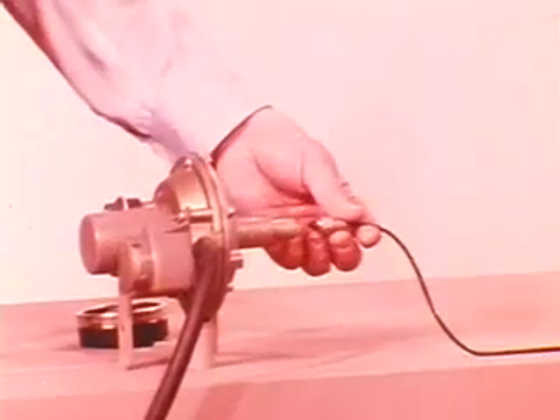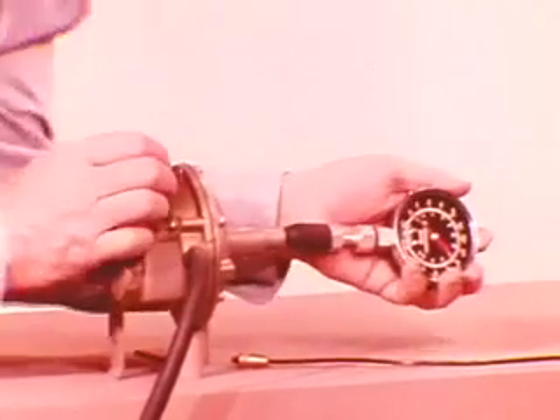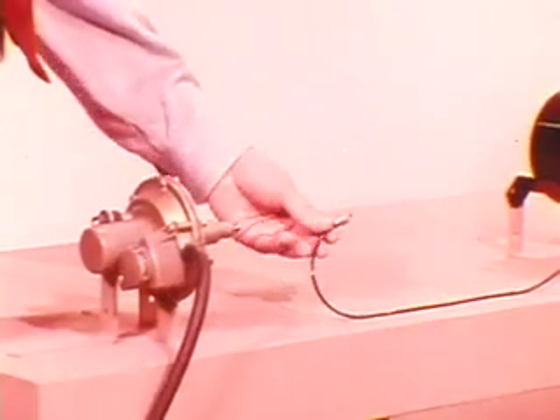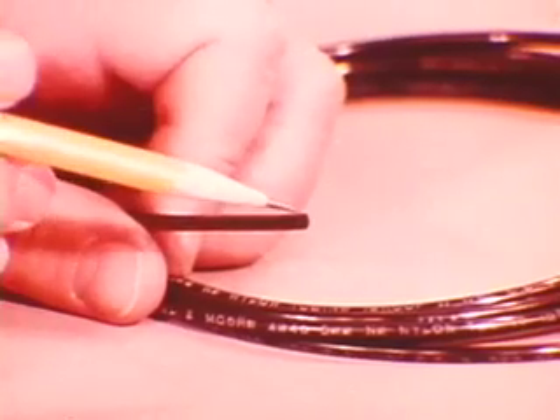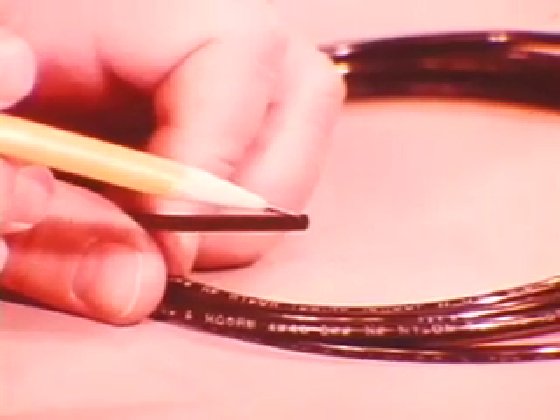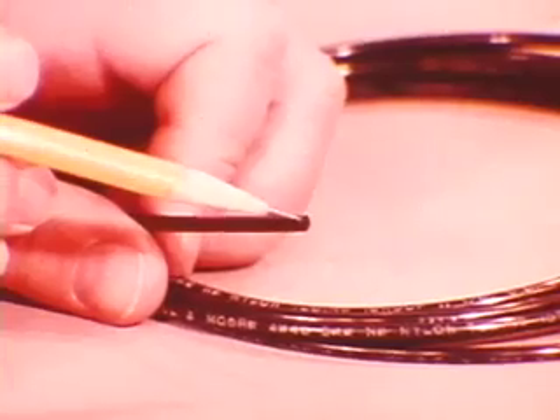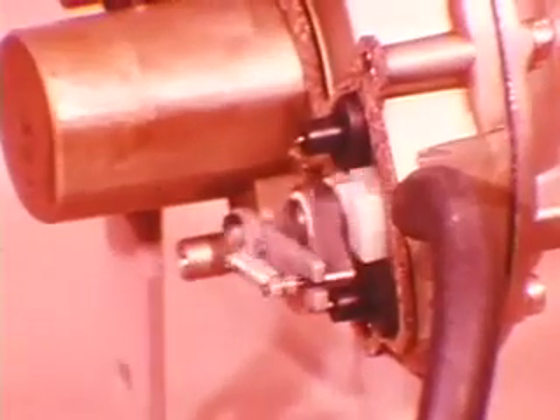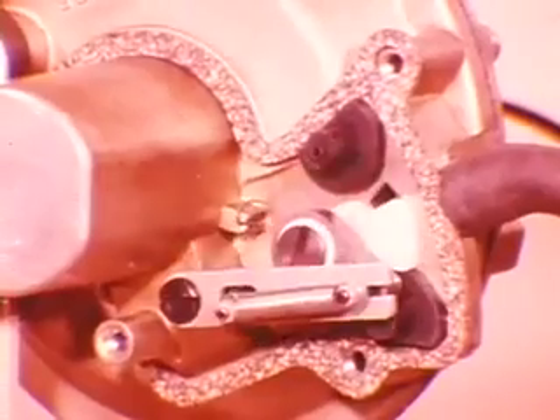Here's how the units work. The two-stage vacuum-driven air compressor supplies air pressure to the reserve tank when the engine is running. Nylon tubing, one-eighth inch in diameter, delivers the air pressure to all units in the system. This special tubing can handle up to 1,000 pounds per square inch without bursting. As the pump operates, a diverter valve trips back and forth as the diaphragm is pulled to the limit of its travel in one direction and then in the opposite direction.